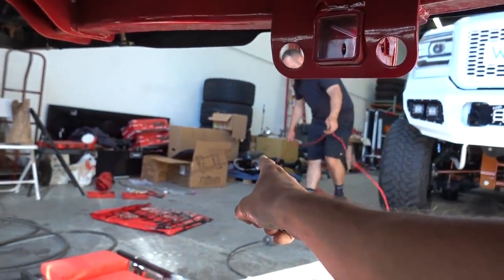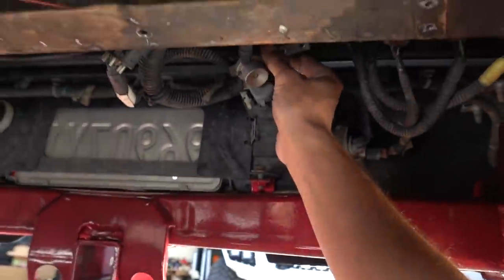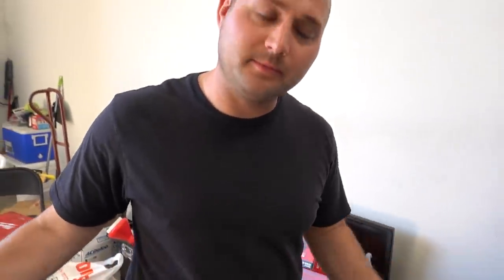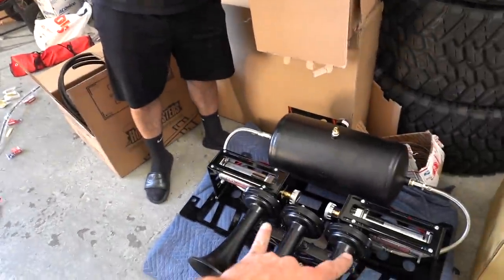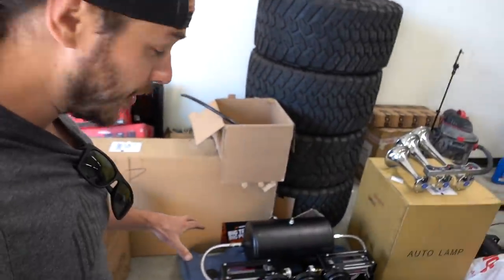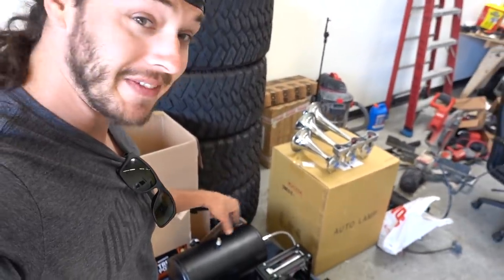We had to move a lot of stuff Wes had already put in place - like his rock lights - because that new big plate from horn blasters pretty much sits flush up against that portion. So these all get relocated once we figure out where we can put them. Everything has been removed. Wes is going to be doing all new wiring from the battery back. On his old setup he was just running one small relay for one compressor - a regular 40-amp Bosch style. But now I'm going to run this Stinger 80-amp high current relay. With dual compressors you want to bump up your relay - those little plastic ones are prone to failing when they get wet.